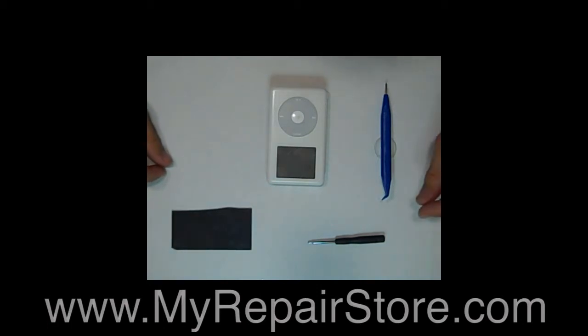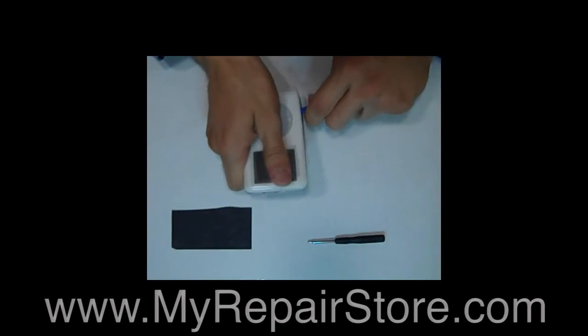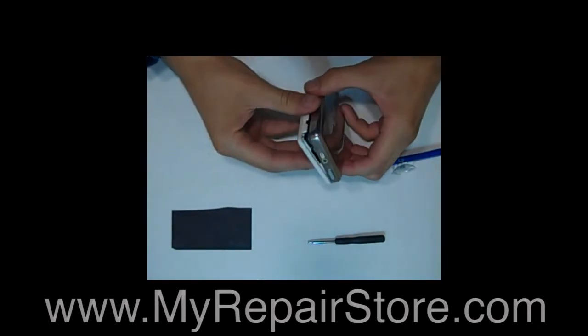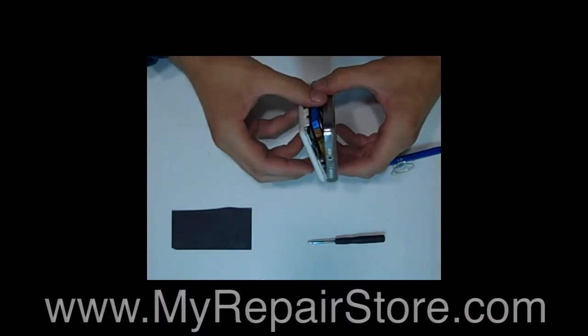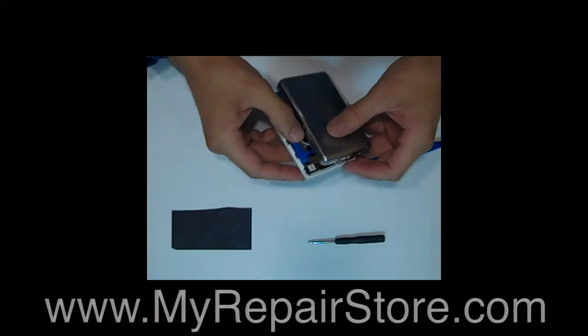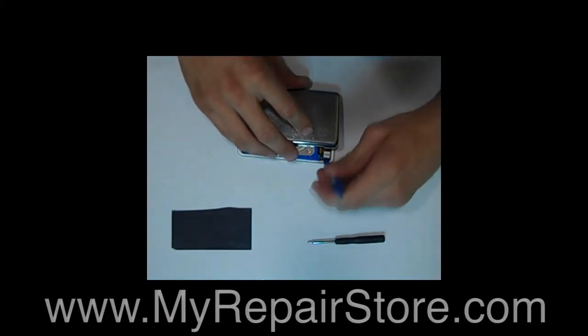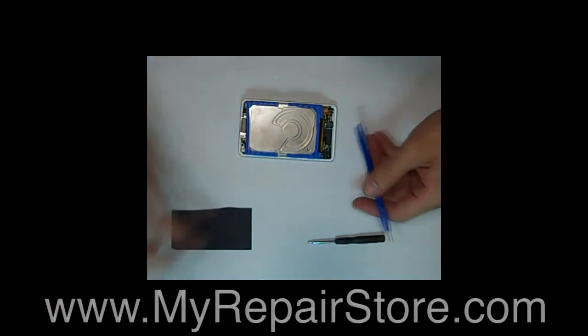So first, what you want to do is go ahead and open up the iPod. Make sure to be careful taking the back plate off of the iPod, because there is still a ribbon cable connected here at the top. Go ahead and remove that ribbon cable, and the back plate should just come away from the iPod. Go ahead and set that aside.